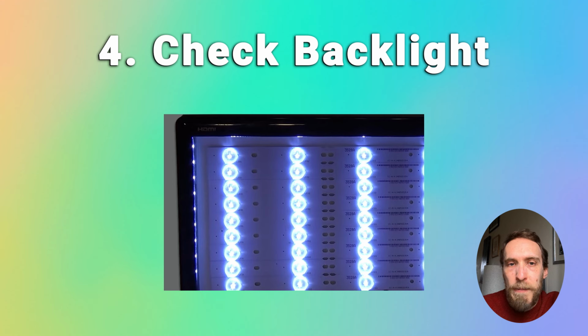So what happens with the backlights is that after 2 or 3 years, the phosphor yellow coating that covers the LED can burn out just from heat. And because most LEDs use blue light LEDs as their base, and they go through this phosphor yellow coating to give out a white light, once the phosphor coating is burnt off, you just have the blue light from the LED shining through, and then that can give the blue tint on your screen.